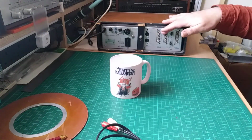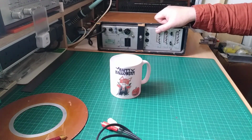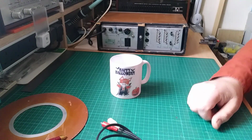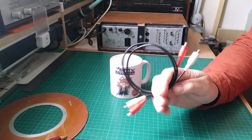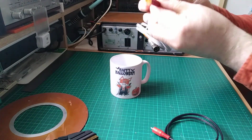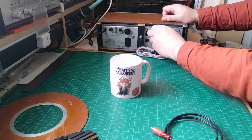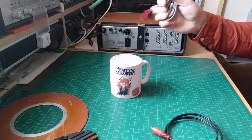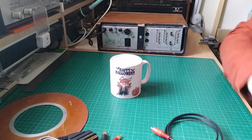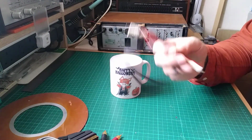was not always of the best quality, although they were as good as they were in the day. But they do tend to corrode a little bit, and often made a poor contact after some time with tarnish and corrosion and what have you, creating a rather crude rectifier between the connections, and with the long leads making RF breakthrough inevitable. But having spent a considerable amount on a new cable, the act of twisting it to fit with a nice gold-plated connector, which a lot of them seem to be these days, as I said, the simple fact of twisting and trying to get that one to fit on there will actually improve the connection. Therefore, making a big improvement on what the cheap cable was in the first place. Again, reinforcing the fact that these expensive cables make a difference. Well, they certainly make a difference to your bank balance, and to a greater extent the manufacturer of said cables.